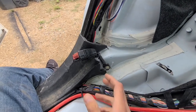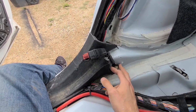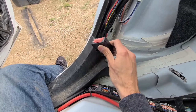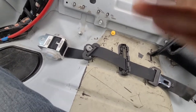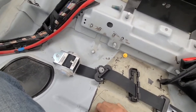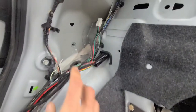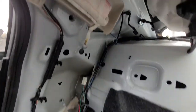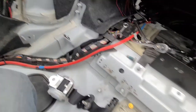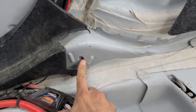On my Charger there is a buckle here — for some strange reason it's not supposed to be here. In your case you won't have this, but I will remove it — it's supposed to actually be here in the middle. Now I've got the belt taken apart. Pretty much what you have to do: the tensioner will be mounted right here at that position, this piece will go above it into this hole right here, and this bottom screw will go into this hole right here where I had my belt buckle.